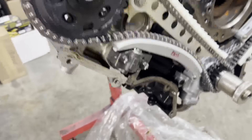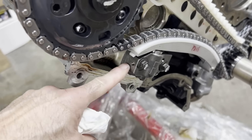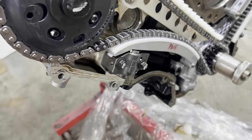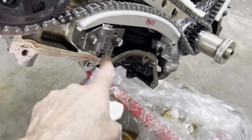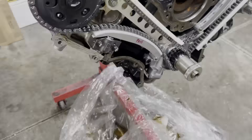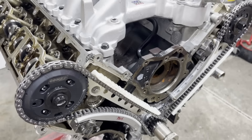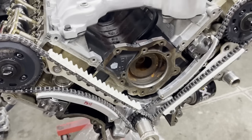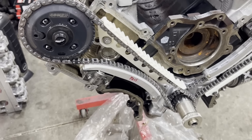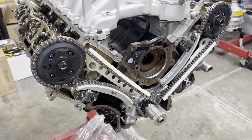What I learned is I basically wasted $150 on new tensioners. If I'd just had a little more pressure or caught it at the right time — what happens is this just shoots oil under pressure at the chain. Before it was just streaming out, but with proper pressure it works fine. The original ones were good. But I know that everything works and we should be in good shape for the dyno. Sometimes we've got to try different things — it totally looked bogus to me, and I didn't want an oil pressure issue with the tensioner causing problems on the dyno. It was worth the time and effort to make sure everything was kosher.